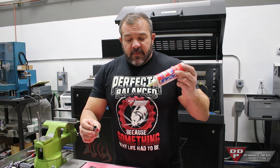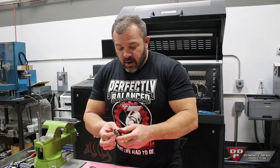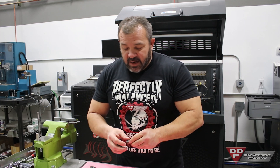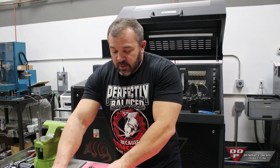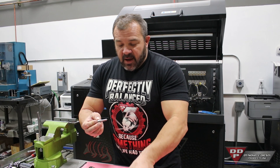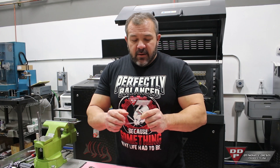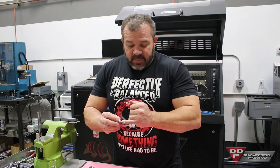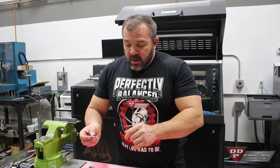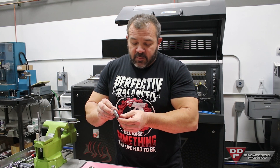When reapplying the nozzle nut, I take just a little bit of this Lucas stuff and run a tiny bit of lube on the threads to make sure they don't get sticky. I also use the Lucas on the shoulder of the new nozzle — it's kind of like when you torque a head stud. If you try to torque a stud good and tight with no lube, it's going to chatter and there's a good chance you'll pop the stud. The lube gives you a little less friction between nozzle nut and nozzle so it doesn't want to pull and pop.